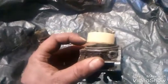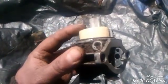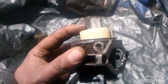The most common effect on a lawnmower, generator, or anything with a small engine is that your float will start hanging up, and it will either not get gas or it will get too much gas and flood out your engine.